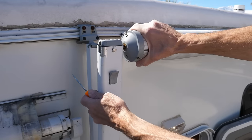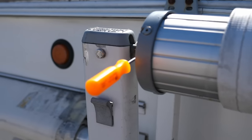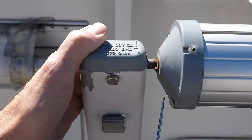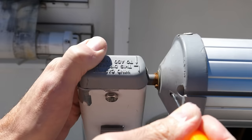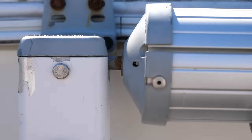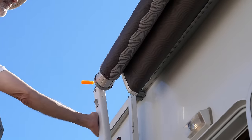The next step is to retract the awning all the way to the RV, then pin the awning slightly open so that the springs do not allow it to roll back up. One side of the awning has a latch that automatically locks it open, while the other side needs to be pinned using a special tool from Tuff Top Awnings or a similar skinny awl. On the end cap of the roller, you will insert the tool into the holes to pin the roller — about 90 degrees to the arm. Unlatch the awning and bring it out a foot or so before pinning it.